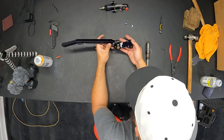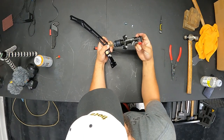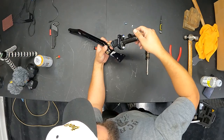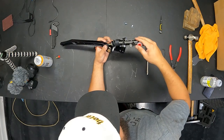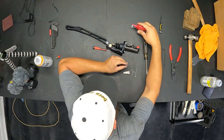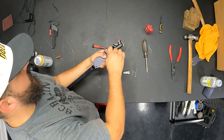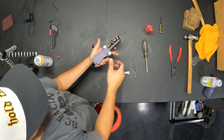Now for my next trick I'll mount the master back and screw it on like such. Sometimes this rod spins inside the master, but because this is fairly new and the tolerances are pretty tight, you can almost spin it with the master — but I'm pulling back on it to relieve tension on the threads to get it to spin in. There it goes — now it's spinning the master without the rod. Then flip it over. Again, use whatever Loctite you feel works for you. Just don't have your crap falling apart. Line up these holes, fill these bolts in real quick, give them a little cinch. Remember we're going into aluminum — doesn't need to be crazy tight, just nice and snug. On top of that, Loctite.